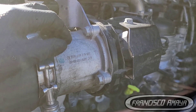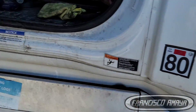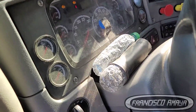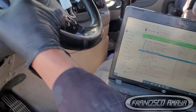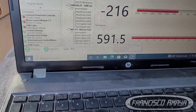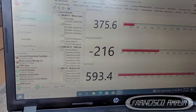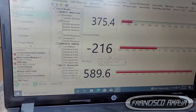What we have to do is modify the computer so we can clear all these faults. I also noticed a problem as soon as I started the engine: there's a fault for fuel rail pressure too high. Looking at the data, I can see the fuel pressure is higher than what is commanded by the computer — there's about a 200 bar deviation. That is no good.